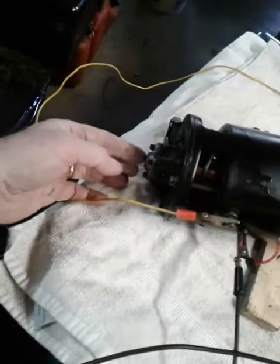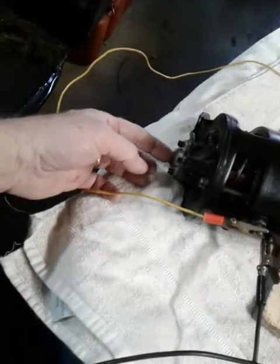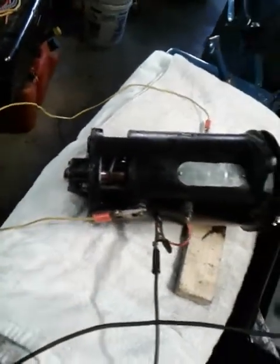Don't try to put oil in there because it's just blocked off. When you do install the generator, make sure you put some 30-weight oil in it, and it fills up to the level of the screws here. There's a little overflow there that'll keep you from overfilling, and that will keep that wick well lubricated.